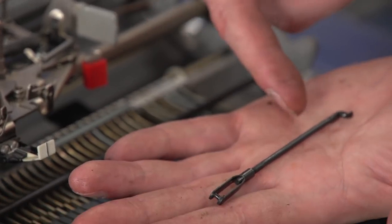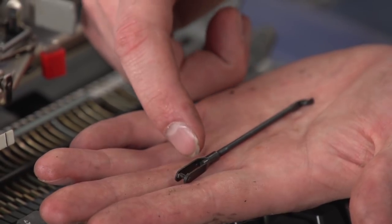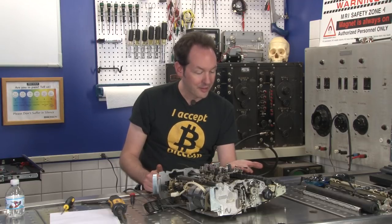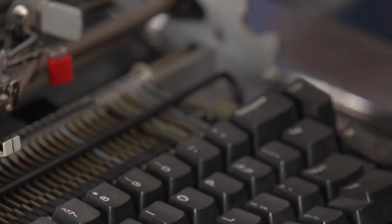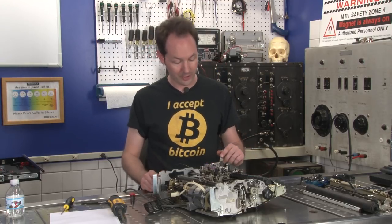This exact setup, exactly, with the Z-bend, the metal shaft, the threaded clevis, the little thing where you bend the part out, is found all over in the world of model aircraft. That's pretty much the standard connection to every control surface on a model airplane, like ailerons, elevators, rudders, all kinds of stuff. I'm setting this one aside because we're going to talk about that in a future video at some point. That deserves its own thing.